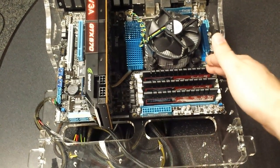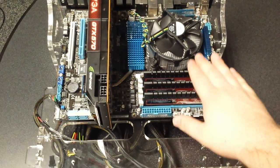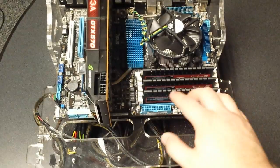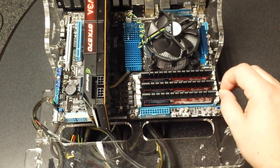You can also check in Windows or another operating system to see how much total RAM you have to make sure it's seen at all. And if you're doing this because of an issue with memtest, you can go ahead and rerun memtest. Also, while you have the memory out, you can use compressed air to blow out the memory slots just in case there's a piece of dirt or debris in there that's blocking it.